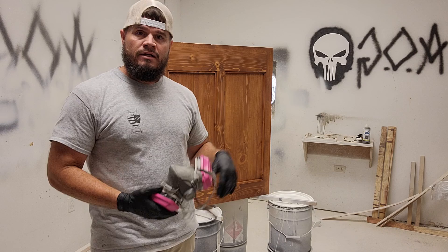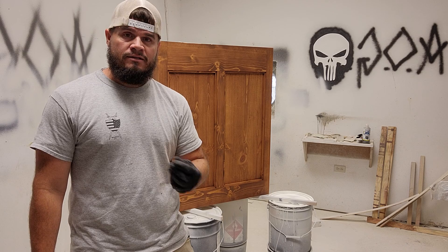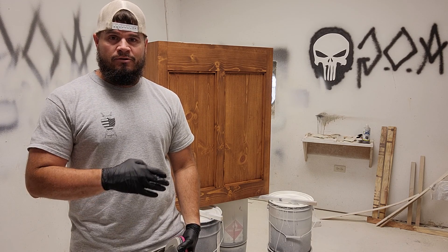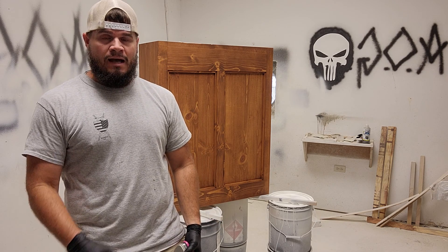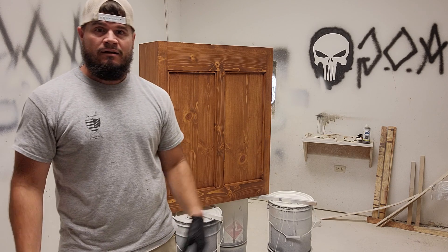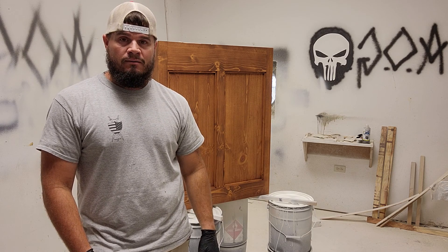The Zara stain is really good. It's a gel stain and you can brush it on, wipe it on with a cloth or a paper towel, or even finger paint with it. Just make sure you let it sit and then wipe it off with a clean t-shirt material rag so you don't have any lint left in the stain. It finishes out perfect every time — streak free. You can overlap the stain and never see where you did that. If you make a mistake, you can always come back the next day, restain it, and you won't have any problems with overlap.